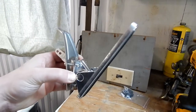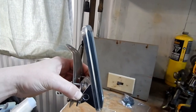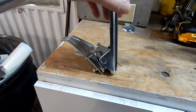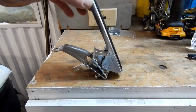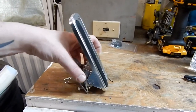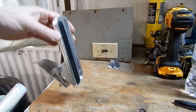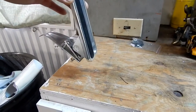It's not ideal for what we have. I can't very well mount it on the firewall because it'll lean and full throttle would just hit the firewall, which seems odd. So I was thinking — what angle does this thing need to be on to be comfortable in the car? I sat in the car and placed it out, and it turns out at about a 45-degree angle it sits nicely so that full throttle is at a normal pedal position. I also noticed I want this near the ball of my foot when my heel is resting on the ground, so I need to raise it about three inches.